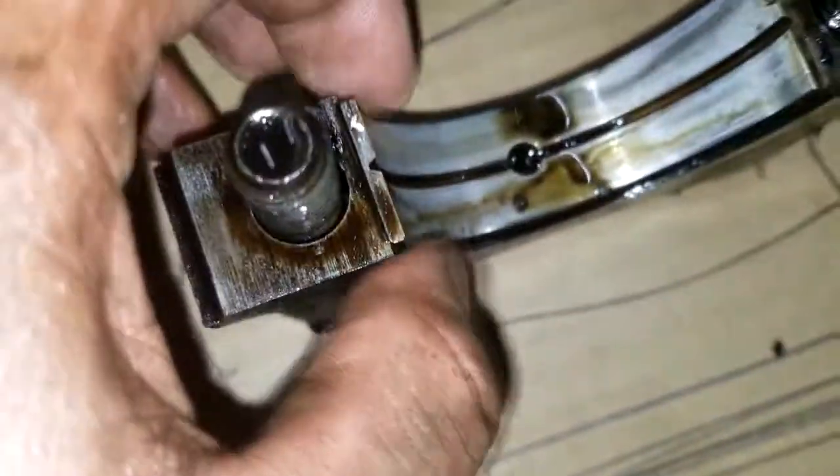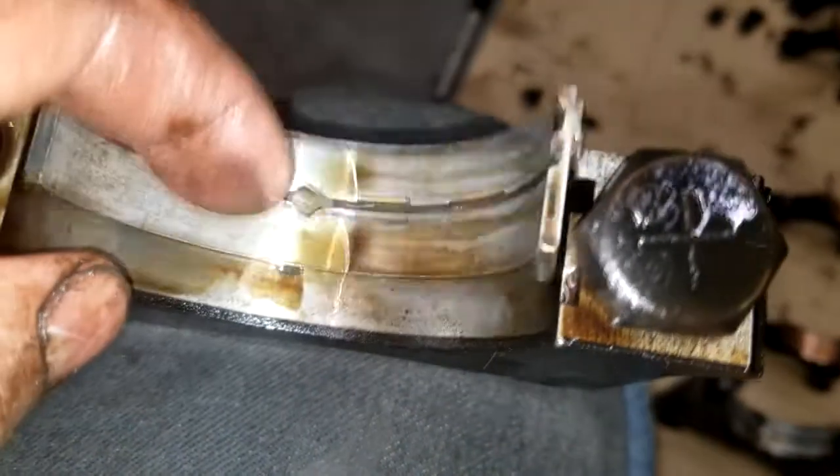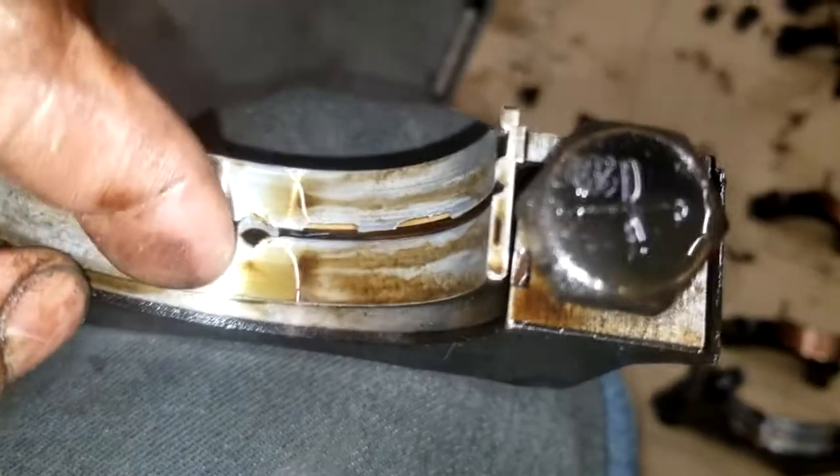I need a sandwich. All right, so what do we got here? For all the main caps, the top bearing is still in the motor, so I didn't want to take that out yet. So we look at the main caps. Well, they're certainly by no means phenomenal. My fingernail... Maybe that's the grit I put on it by picking the damn thing up, but...